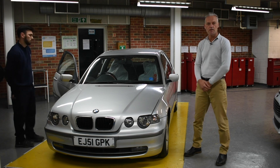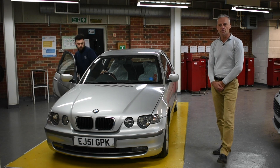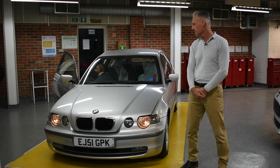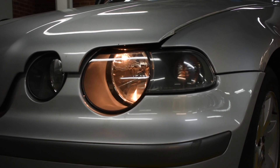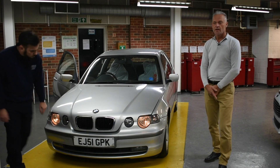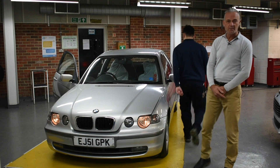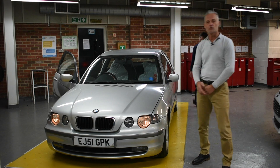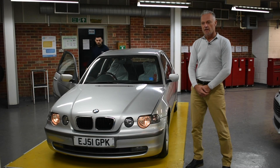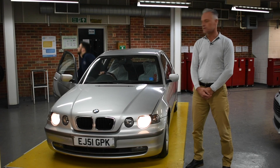Initially, Luke is going to get into the vehicle and check the lighting system. The first check he's going to do is the side lights, which are the four position lights on the vehicle. These should always show white light to the front and a red light to the back. The white light to the front shows any motorists you're going towards them, and it's a red light at the back to show any other motorists you're going away from them. If there's any damage to the rear light that will show white light, so that's why it has to be replaced.